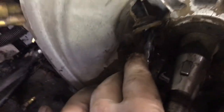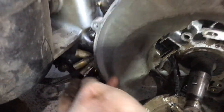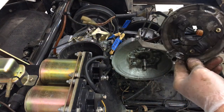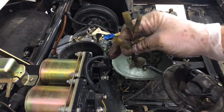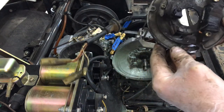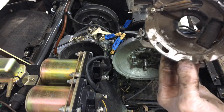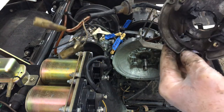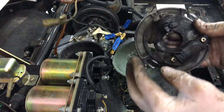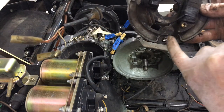That was easy - I just gripped the wire a little more and the grommet came right out. Now it's just a matter of feeding the wire connectors through the hole in the crankcase. You can see the grommet and wire connectors - there's not a lot of excess wiring. I'm told these stators are very expensive to have rewound if you can even find someone to do it, so this one appears to be in good shape. You can also see the scribe marks around the screw heads that I made before removing the screws.